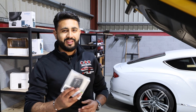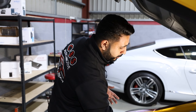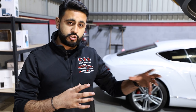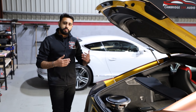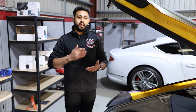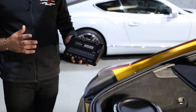That's the amplification stage. We've also got a distribution block for connections wiring. Throughout the whole system it's going to be Connections wiring. Wiring, fuse distribution, and safety are very, very important — not only for your own safety, ensuring the install is done well, safely fused, and all cables measured correctly, but also for actual sound quality. There's no point having top-tier products if your cabling isn't up to scratch. That's why we always run new cables in alongside manufacturer wiring to maximise output. Power cable, distribution cables, signal cables — every element will be Connections wiring.